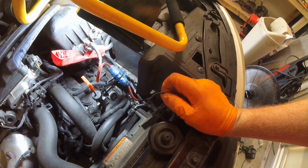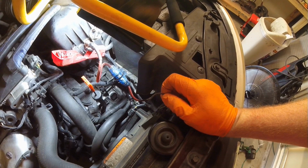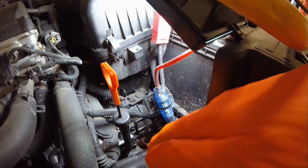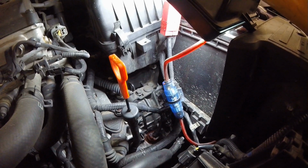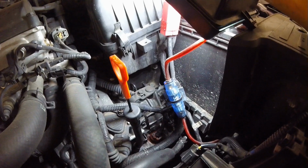When you push on the back side of that plug, you want to try and push on the edges, not in the middle, because in the middle is where those solder joints are that give you problems. One more challenge is on the wire harness on the top of the transmission here. I talked about that rubber O-ring that makes it a little bit difficult to install the wire harness from the bottom up, but the other thing is the actual connector that's on there.